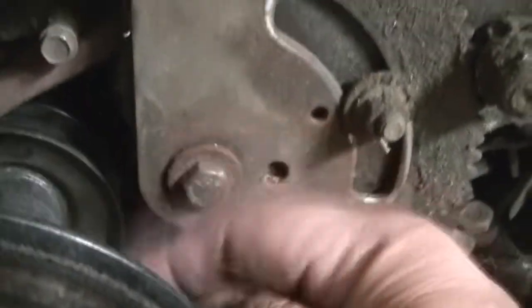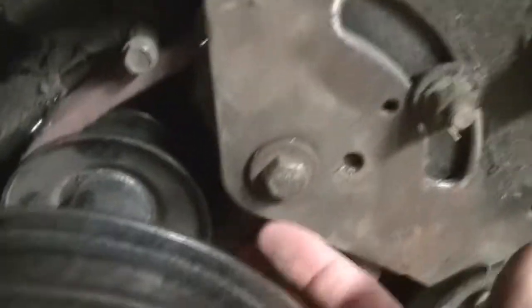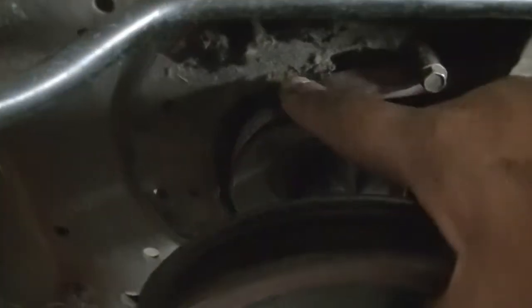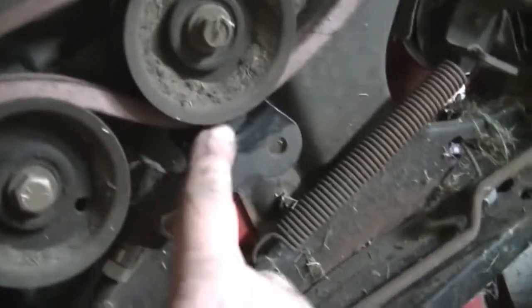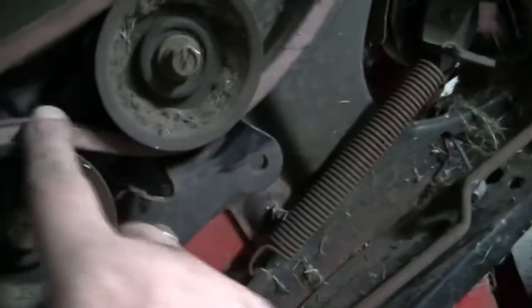This guide, it is below this guide, and in case you are wondering, this screw is not in the way. It is a half screw, so there is enough space behind it. It does not restrict the movement of the belt at all. It can go over this screw easily. So this activity is easy. You can slide this out, put the belt on the pulley, just push the pulley in within these guides, and that's it. And on this side, the belt has to be pushed in between this, which is easy, no problem, it slides in easily.